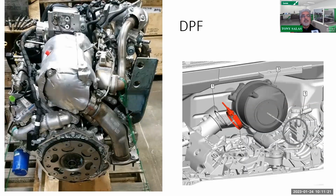All right, so there's a picture of that catalyst. For those of you who have not seen an L5P, that's the one right after the turbo. This is the back side of it. It is not going to be fun. Any of you that have done these already, you're going to find out that the turbo would probably be best removed because everything's so tight. But here's your mini downpipe going down to where it meets the rest of the exhaust system. You could uncork it, but the problem is you've got this guy in place. This is the bung right here for the NOx sensor. Like I said, you can take out the NOx sensor and that'll show you what's going on right there.